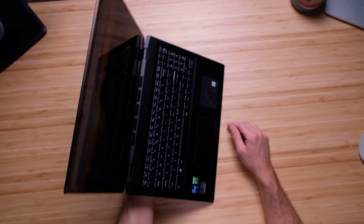I recently reviewed the MSI Creator Z16, and it was thin but a little on the heavy side, so I like that this laptop is a bit lighter. One area of concern from the comment section was the vent on top of the keyboard deck — everybody worried it would blow hot air onto the screen. And yes, it does blow air onto the screen. But because of the excellent thermal temperatures due to the mobile processor, it's blowing about 70 degrees Celsius, not the 85 to 96 degrees Celsius we see from H-series processors like the Asus Zephyrus M16. The difference in heat from the bottom to the top of the screen is about five to seven degrees Celsius — nothing drastic.